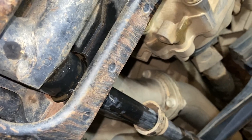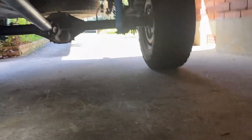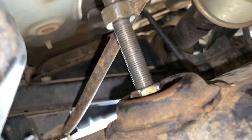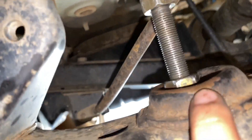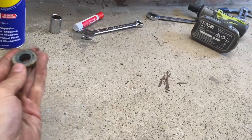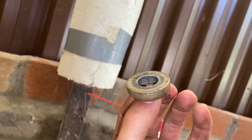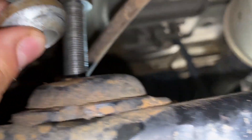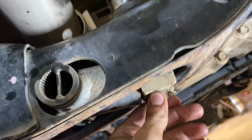This is the side I wasn't supposed to be filming, but you can see here how sunken that nut is into the circle piece, whereas over on the other side it's sitting up — that's because there's a cone underneath. The side I'm not supposed to be doing doesn't have the cone, so it's crushed into it. Before you go undoing your torsion bars, check that you have the cone there. Luckily I had an extra one off an old cross member. The torsion bars include a little cone piece — all it does is sit on the bottom nut so the bottom nut sits on top and centers in the cone. I've done about 25 or 26 winds and the whole thing is shaking, so there's no tension on it now — I'll rip the whole bolt out.